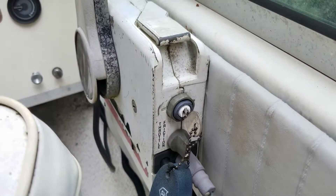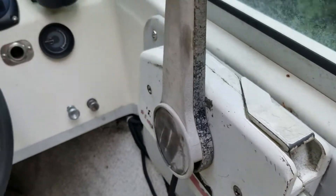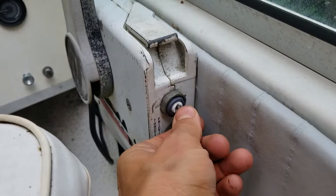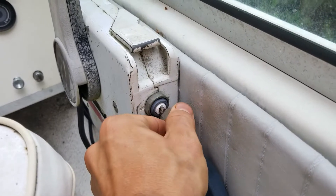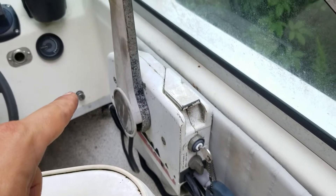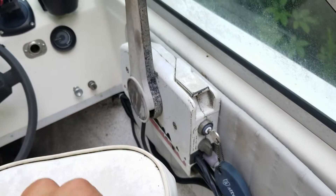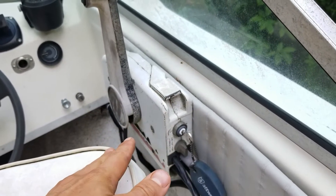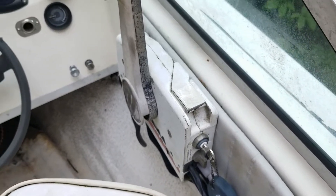Alright, so you can see this old boat — it's like 1979, these controls — but it still works. You can see right here, this does not have a safety lanyard anywhere. Not at the helm, not anywhere. It's built into here. So it's not the same thing as the safety lanyard. This is more of a kill switch to turn the engine on and off. The safety lanyard is basically just wired in the chain — it comes here, it goes to the safety lanyard. If the safety lanyard is off, it won't start, the key won't do anything. If the safety lanyard's on, the key will work. So you need to check the safety lanyard like on that other boat I showed you. If you pull that thing off, your boat is not starting. I'd start with that switch on most boats — that's where you want to start with the kill switch circuit.